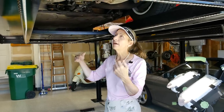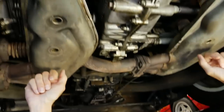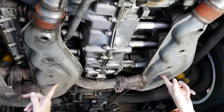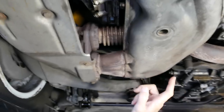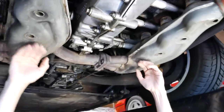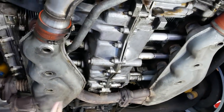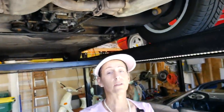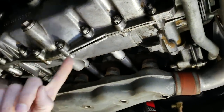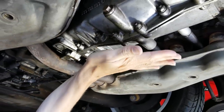The work we're going to be doing on the engine is mostly just the top end since we'll have it out — why not? We've got some rumbling and issues in the transmission, so that's our biggest focus. Take a look at these guys here — they don't look very strong and they're not. These are the heat exchangers for the heating system. Exhaust manifolds come down from the cylinders and flow through these for the heating system. They look like a wonderful platform to set the engine on, but they can't take the weight — they're just pressed steel and would deform. The spine of the engine where the case comes together is the strongest point, and you can literally jack up the back of the car using a soft pad on that spine. That is where we need to set our force when lifting the engine.